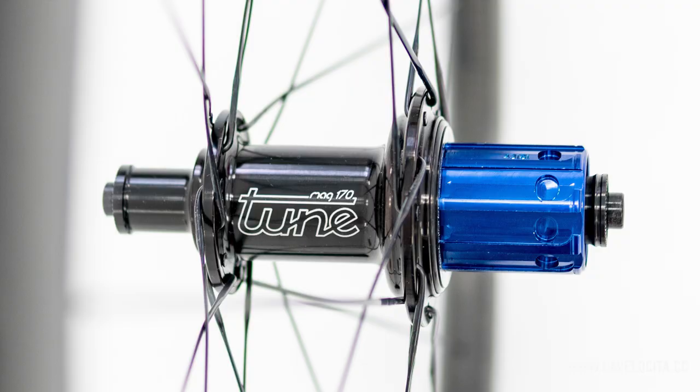There are really only a couple of problems. The light freehub body means the cassette will kind of bite into it over time. These have had a few years on them and quite a few thousand Ks, so they're starting to show a bit of wear. The other issue is they have titanium pawls in them, and they tend to wear out a bit quicker than the pawls in other hubs. The pawls in these wheels got replaced after about 13,000 kilometres. You want to keep an eye on them because once they wear out they can start to wear out the inside of the hub itself — so just make sure you're keeping on top of maintenance, and they'll be fine. Other than that, big fan of the Tune hubs.